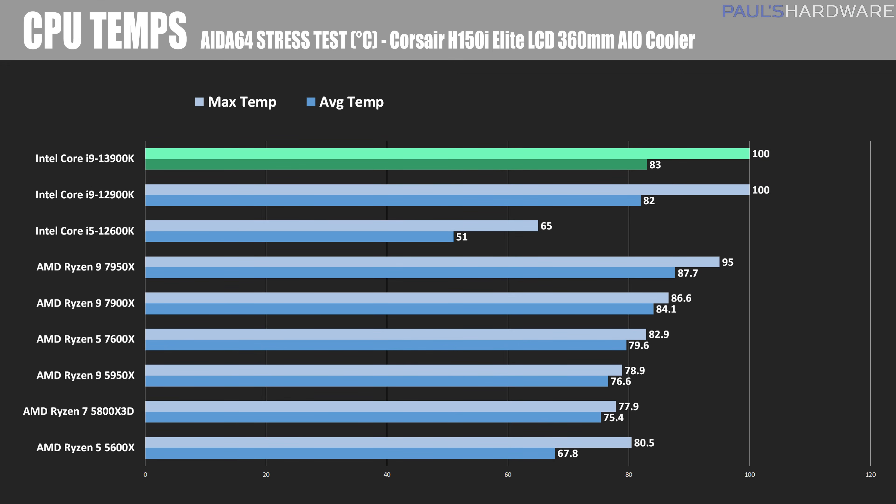Here are the temperature comparisons, showing the average core temperature after the 10 minute AIDA64 burn-in test. You'd like to think that a 360mm AIO running at 90% fan speed could tame the heat a bit better, but at least AMD and Intel are now both in the same boat, so either it's a wash in terms of temperatures or we can criticize them equally. AMD's max temp for the 7000 series at 95°C is lower than Intel's at 100°C, but the 13900K managed a lower average temperature, staying remarkably close to the 12900K. Note that Intel motherboards are quite inconsistent when it comes to power settings — the MSI MAG Z690 I'm testing with does not limit the chip at all by default.